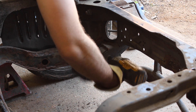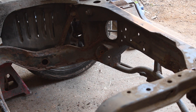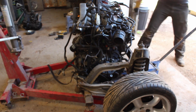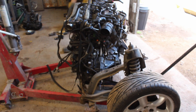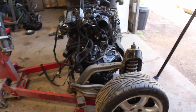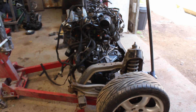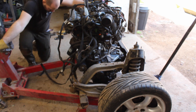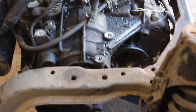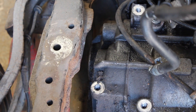I'll fabricate an engine steady to suit once the main mounts are made. Once more into the breech — this time the fit is remarkably good. The gearbox diff sits nicely in the recess of the subframe. The output shafts are in a reasonable position, and the engine and gearbox mounts even line up with the original mounting holes. There's even plenty of room around the K04 turbo.